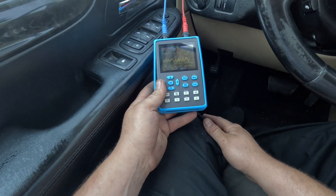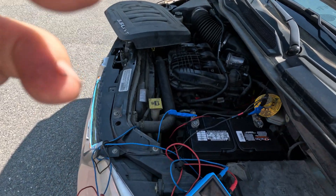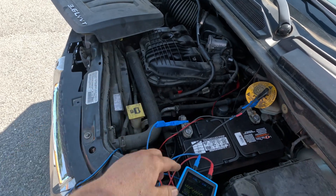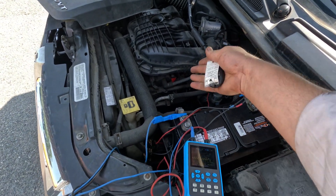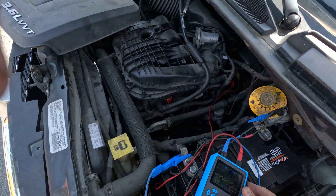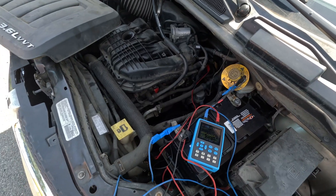I forgot to mention: in a situation like this you can just plug in a scan tool, see which cylinder is misfiring, and then you know which is your dead hole. Then if you don't fully trust your gauge you could do a manual leak-down test or whatever you want to find the actual problem. But here, they're not putting too much work into this — they just want to know why it's misfiring. Thanks for watching.